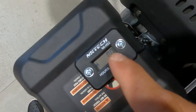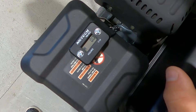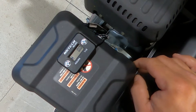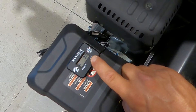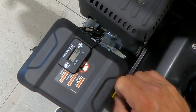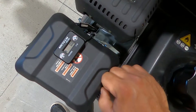You can see these numbers right here. There's a little hourglass — when this thing's running I'm thinking this hourglass should flash on and off maybe every second or so, but it will only do that when the engine is running because you only want to record the runtime. This is in one-tenth increments, so a tenth of an hour is six minutes — to increase by 0.1 you'd need to run the engine for six minutes. I'm going to start the engine up and we should see it start to count.